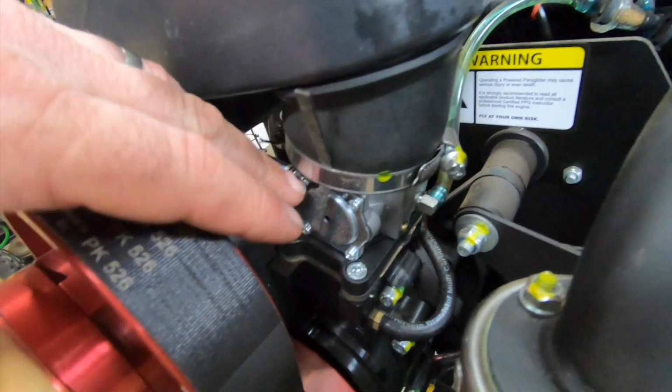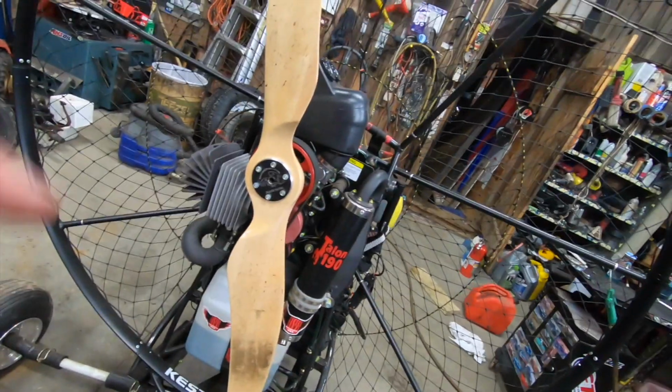advice, but it's been my experience that with these style diaphragm carburetors, see, it's just a giant weed whacker, or a chainsaw carburetor is all it is. You got your low and your high speed screws right there. Can't really get in here. Your typical diaphragm carb is just supersized. I've found every time you leave that style dry, drain the fuel out, let it sit over the winter, you have nothing but problems. I should have taken my own advice and just left all the fuel in there, even if it did have ethanol in it. I think it would have been better off.